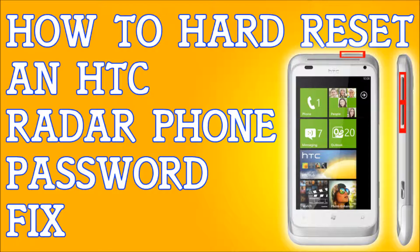If you do have access to your phone, it's going to be even faster. From the start menu, tap the little arrow with a circle on the top right. Tap that button and search for Settings — scroll down until you find Settings and click it. Go all the way to the bottom and look for About. Click About, then select Reset Your Phone. It will give you a quick warning, then tap Yes to confirm and you're done. That's how you hard reset and soft reset an HTC Radar.